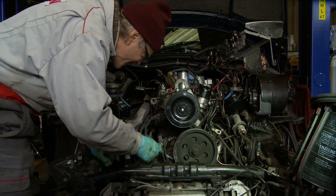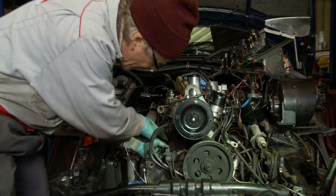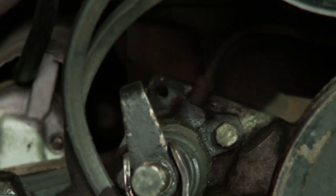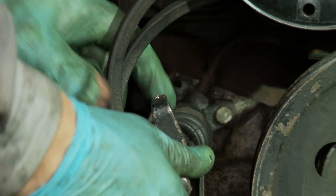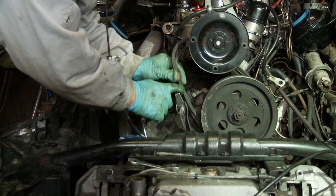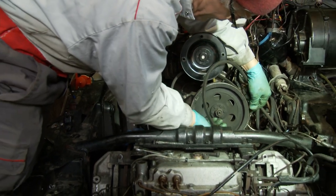Having slackened the adjuster right off — there's also a piece missing to do with the return spring. The return spring has been hooked into a hole at the back, but officially there should be a little clip bracket which is missing. Again, it was working but it's incorrect. Taking the spring off and disconnecting the clutch slave cylinder, which has a push rod in the middle. With that out, I can now feed the belts through. You can see how awkward this is even with most of the car apart — trying to change these belts when everything is still on it.